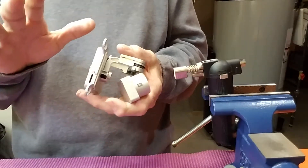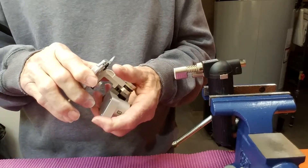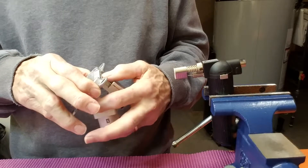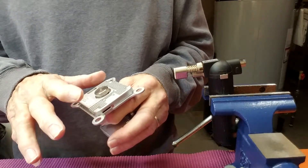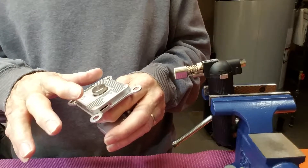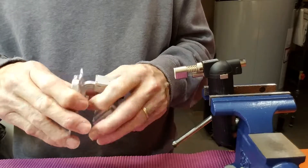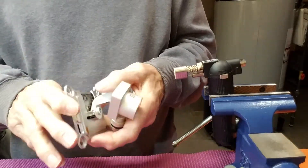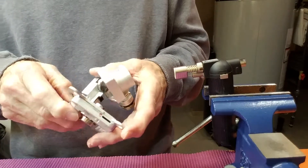Once you've done that and you can see it's going to work — you have good video pointing straight ahead — but it's on the shaft and not on the flat spot. At this point you can do one of two things: you can stop and tighten it down on the shaft securely and just fly your drone, or you can move the magnet, which is a more permanent solution for this particular problem.